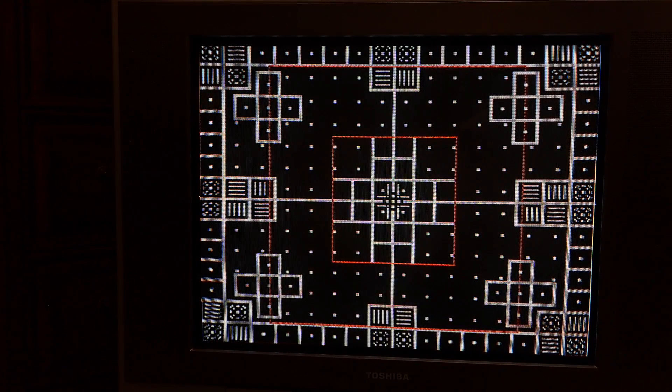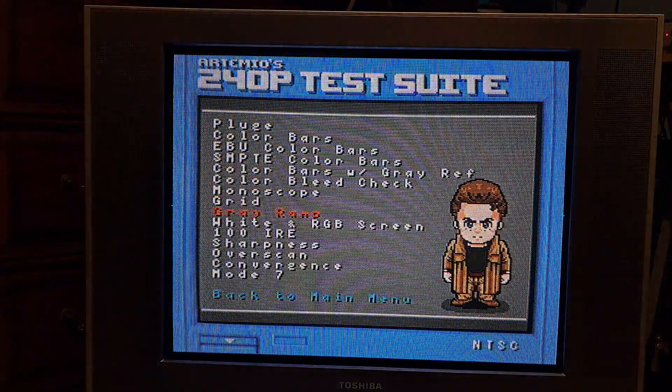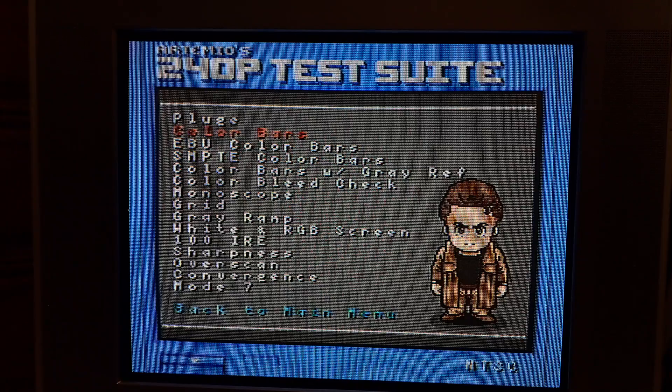Here is the monoscope pattern — same thing. This is a really useful tool to check your corners for geometry and adjustment of that sort. You can see the centering is pretty solid and overall everything looks pretty good. Over here is convergence — this dot pattern is what I use a lot. As we get closer, there is a little missed convergence, but because it's a 20-inch set, you're really not going to notice anything like that in real time while playing video games. You don't want to spend too much time trying to fix stuff you can't really fix, because if you do something to one corner, another corner is going to get inadvertently affected — usually opposite corners. So you have to be really careful whenever you're adjusting anything of this sort.